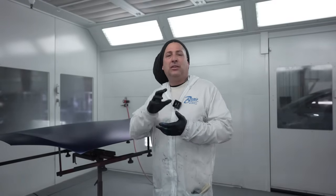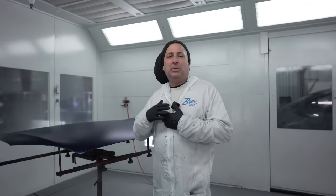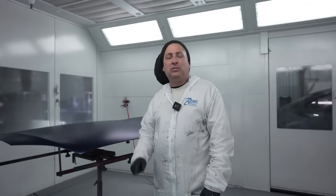You can see we have a beautiful flat finish with our sealer and base, and that's going to ensure a nice top coat because our foundation is flat. The DC 50-50 clear coat is mixed three to one, and it's a high-solids clear coat. What 'solids' means is after the solvents come out, what is left on the actual car or parts you're painting — it's going to last longer and give that much better shine and holdout. So we're going to mix this up and get it cleared.